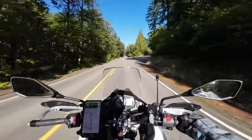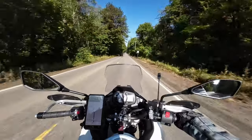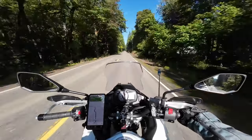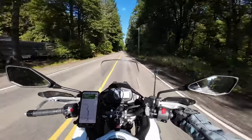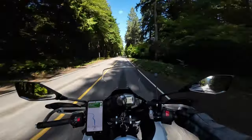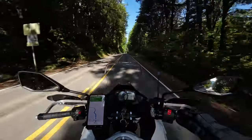And being a 180 degree parallel twin, this thing doesn't run out of steam on the top end like you would on a single-cylinder dual sport, like a 300cc KLX. It makes the bulk of its power in that top 25% of the rev range that you have available. And so when you're on the highway, it actually has pretty good passing power at 70 miles an hour.